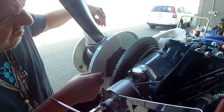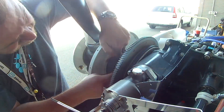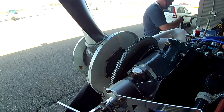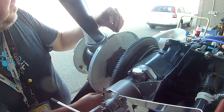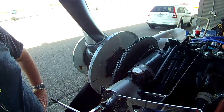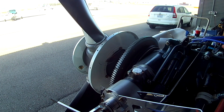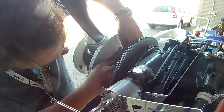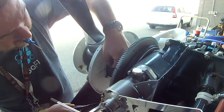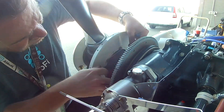This is just one of those long list of things, like — wouldn't it be nice if I could safety wire the prop bolts on? It's not really too difficult. These prop bolts require about 40-ish — I think I'm doing 42 pounds of torque. And then, of the six bolts, you will safety wire them together. So I'm doing three sets of two.